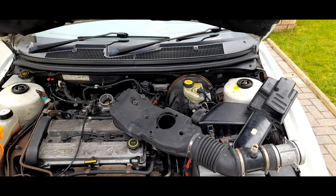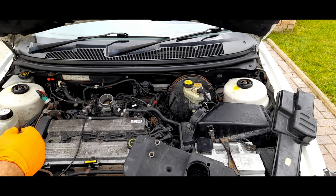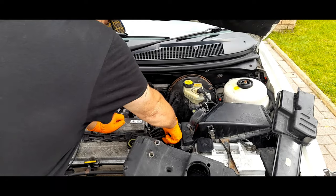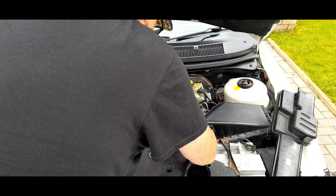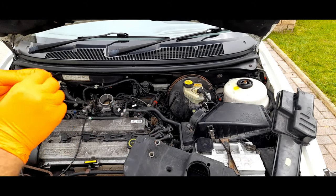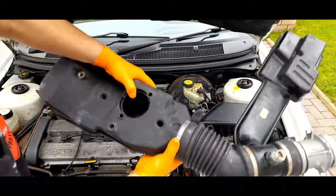Further investigation — I just took the car for a little spin down the road with the air box off. I thought, well, it should technically run okay — it wasn't. It was still missing. Which is only pointing to the HT leads, and I know I was getting funny sparks from those. So I've ordered a new set of HT leads. Those little rubbers I showed you earlier — all they are is just cushioning rubbers, they don't actually act as an air seal.